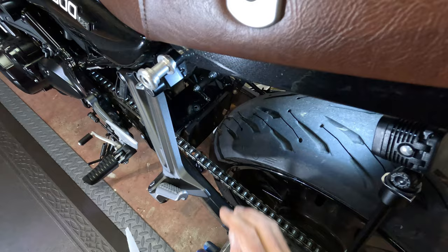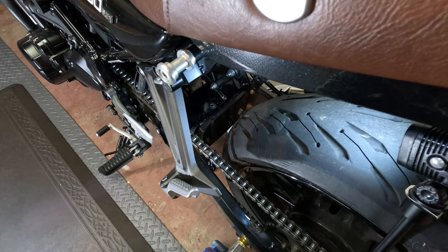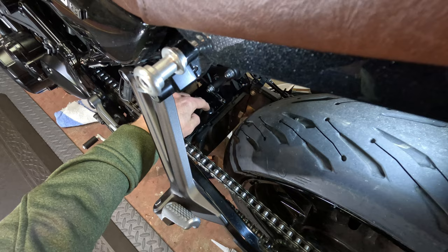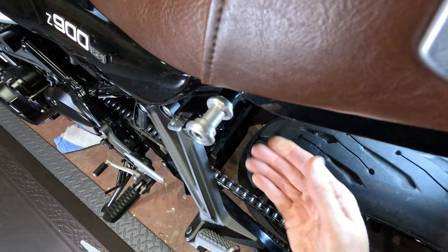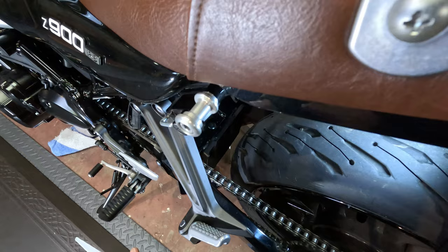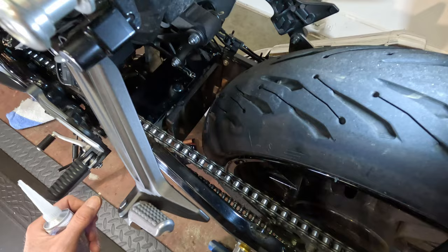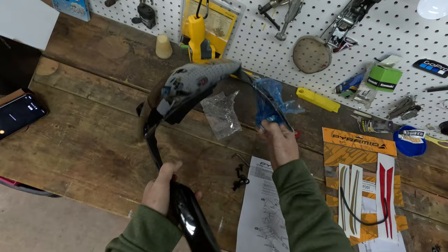The new hugger should touch down here and leave this area open. You can see where the plastic covered it — some scuffing and a bit of pitting. I've put the little plastic fixing back into the hole that will be left exposed, with a little ring of silicone Permatex UV-proof sealant underneath it, then pushed it in. Don't push the middle pin down yet. I just don't want water getting into the swing arm and rotting it from the inside out — better safe than sorry.